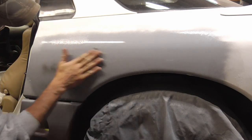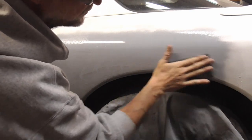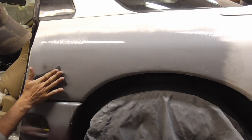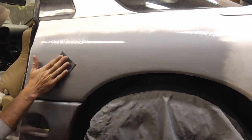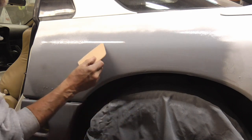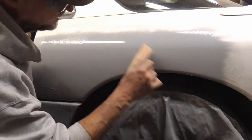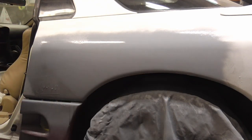And it actually is pretty relaxing. You just keep sanding until it's all smooth, 400 grit or 600 grit or 320 grit scratches. And once again, the biggest advantage is you can clearly see what you're doing. And that's really smooth, and that's done. There's no black left in any of the orange peel. All the orange peel is gone, all down to 400 grit scratches.